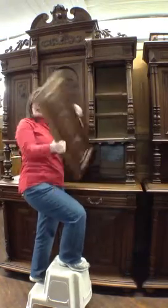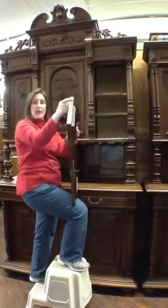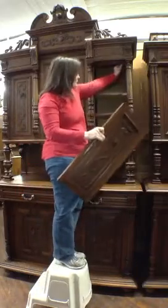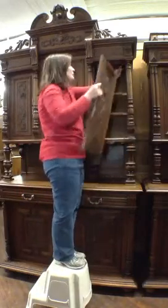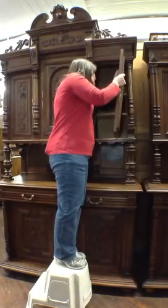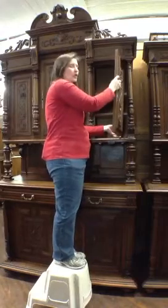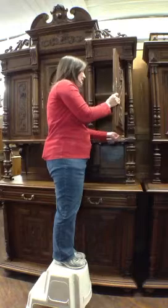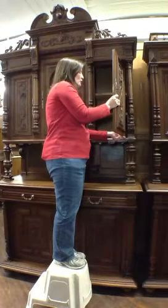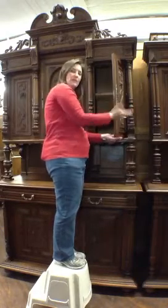To hang the door back up, take that metal slide and look here in the door jamb where there's a little hole, and put that pin into the hole. It's good to turn this metal slide kind of coming straight out. Then make sure you have the door the right way — you'll know it's the right way by having the metal pin up at the top that's affixed. Look inside the door jamb, find the little hole, and line up the pin in the hole. Sometimes it just takes a minute to see because it's dark in there. Once you have that in the hole, apply upward pressure on the door to hold it in place, then gently line up that groove on the underside of the door with that metal slide and slide the piece on just like that.